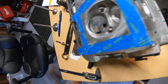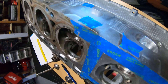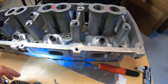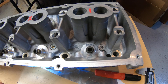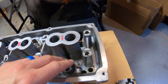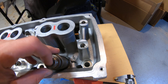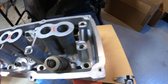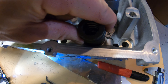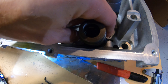You can see why this is junk. Let's do a little comparison — let me turn these over. I want to show you something. This is a main cause of valve train noise: the factory lower shim washer and the OEM spring. Look at how much wiggle there is compared to meeting concentricity properly.